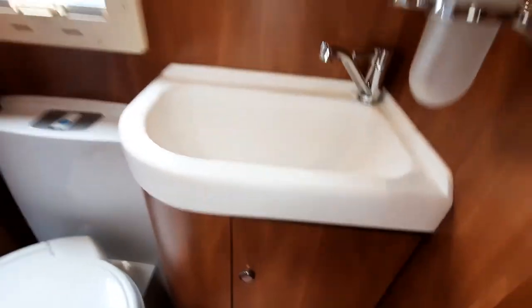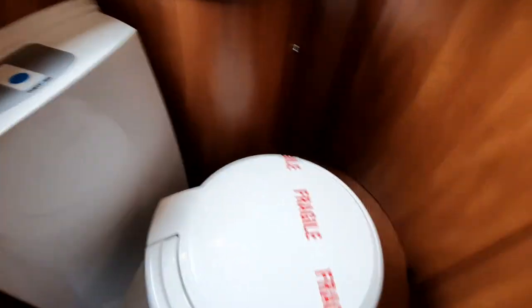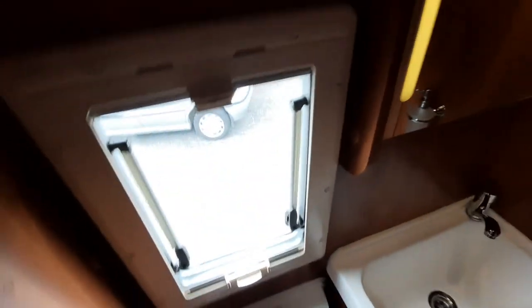In the bathroom area: toilet roll holder is located there, mixer taps, a plug socket, and a 12-volt socket. Your window, toilet, flush, and indicator are in here. On the toilet, keep the blade valve closed — pointing towards the shower means it's closed. Turn it towards the sink to open it, then pull it back to close. To allow you to pull the toilet out there is ventilation up there for shower steam.